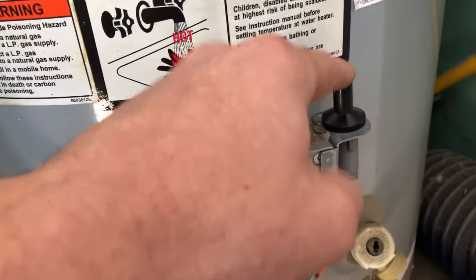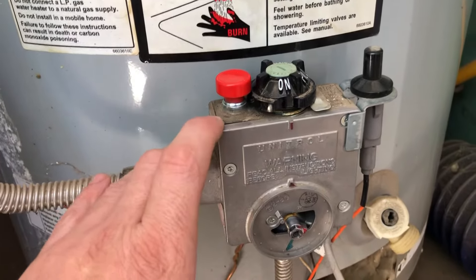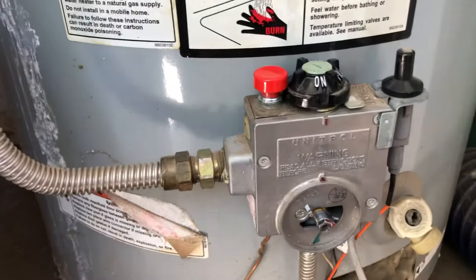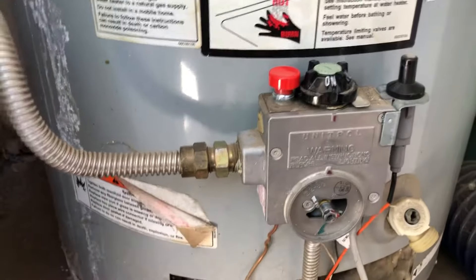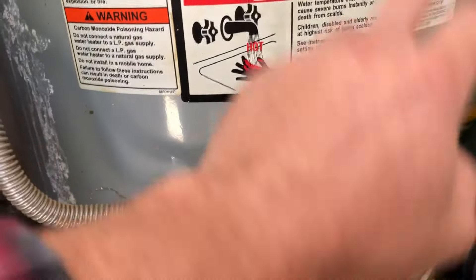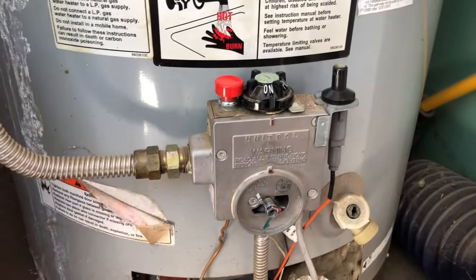This is your pilot button and this is your igniter button. You need to press and hold the pilot button and, whilst depressed, go ahead and hit the igniter, then wait — give it at least a second to get some gas out before you hit the igniter again. Once you've hit the button and the pilot lights — which you can see through the little window — you can release the igniter button, but you must keep holding the pilot button down.